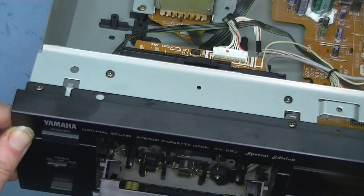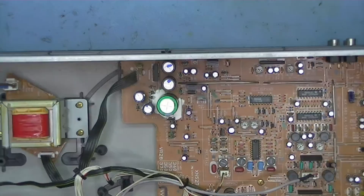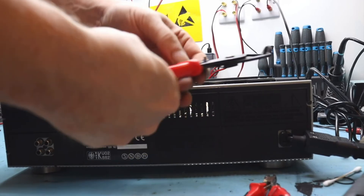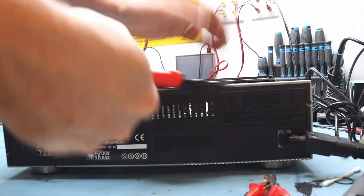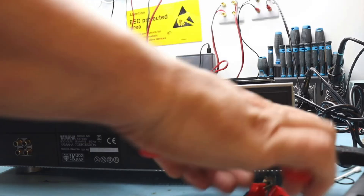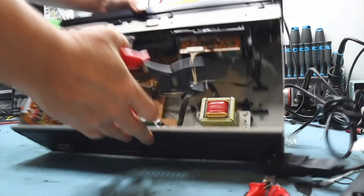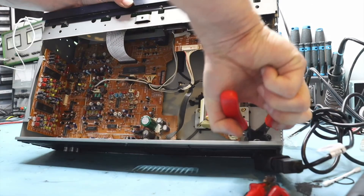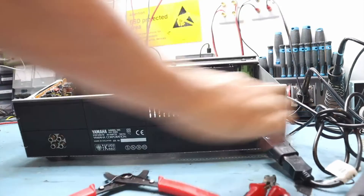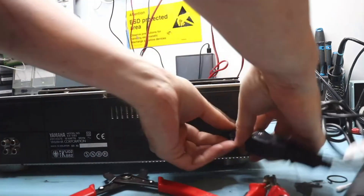The heads look clean so I think we'll just give them a good clean. We'll remove that grommet first — let me get my grommet remover. If you don't have one, a good pair of flat-nose pliers will do the same job, but the easiest way is to use one of these. It's just a case of finding the right angle and squeezing it out like so. There we go, it's out and we can reuse it.